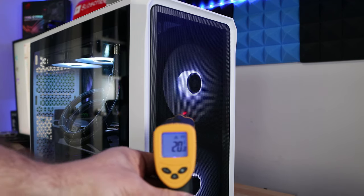And at the very top of the PC, we're about, let's say, 3 inches from the radiator. Directly above it, we'll hit about 39 dB. Oh, 41. So incredibly quiet there as well. And even though we're testing the GPU, 32 degrees, it is exhausting that heat.